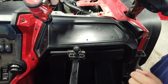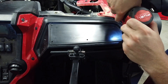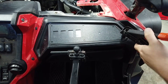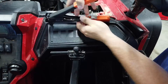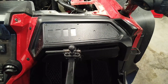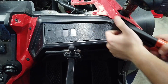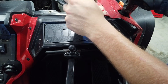We're going to grab a 3/16-inch drill bit and put a couple holes in there for the new locations. I'm going to put the first four rivets in and then come in and drill the remaining holes while the plate is in place, just so I don't end up with misaligned holes. Now that we've got our outside four rivets in, I'm coming back in to do these while everything is lined up.